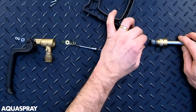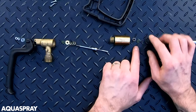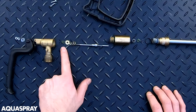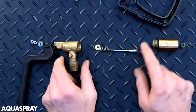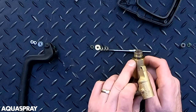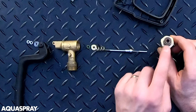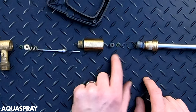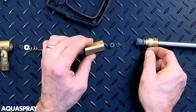So that is how it goes. What things to look for: you've got the green o-ring on the back - if that's damaged, it will leak out of the back end. If it leaks between the housing, then it'll be this o-ring here. If it leaks through the gun trigger itself, it can either be this bit here that's damaged, or these o-rings - the little green one. If it's leaking out of this hole, it'll be this o-ring that sits on this recess here.